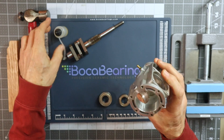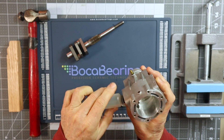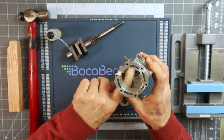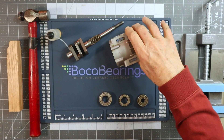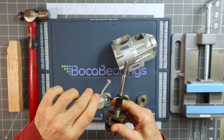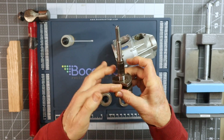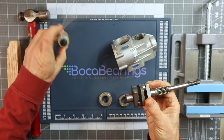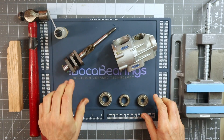I'm going to do the same thing on the inside here where this mid bearing is going to reside. It's a little bit tougher to get in there, but I'm just going to put just a little bit of oil in there to make sure there's a little bit of lubrication so that when these go on they'll fit on easier. And I'm going to do the same thing on the crankshaft — especially this area here where the mid bearing is going to go — and of course the rear bearing area.